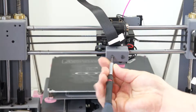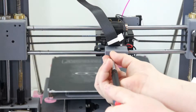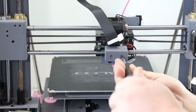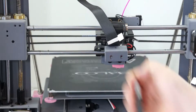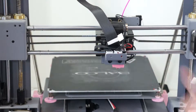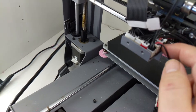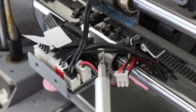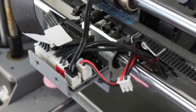The first step is to turn your printer around. On the back of the print head there's a little plate that protects all the plugs where the electronics connect to the little board. Just take the two screws off and remove that plate. Once it's removed you can get to all the little plugs at the back, and you want to take out the little black plug closest to the linear rail.